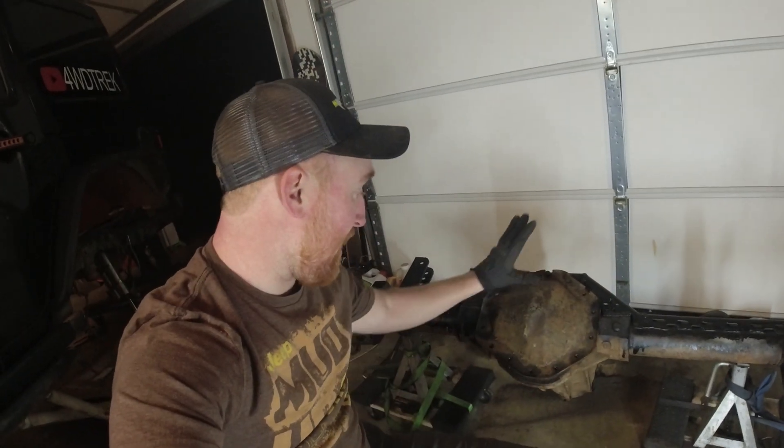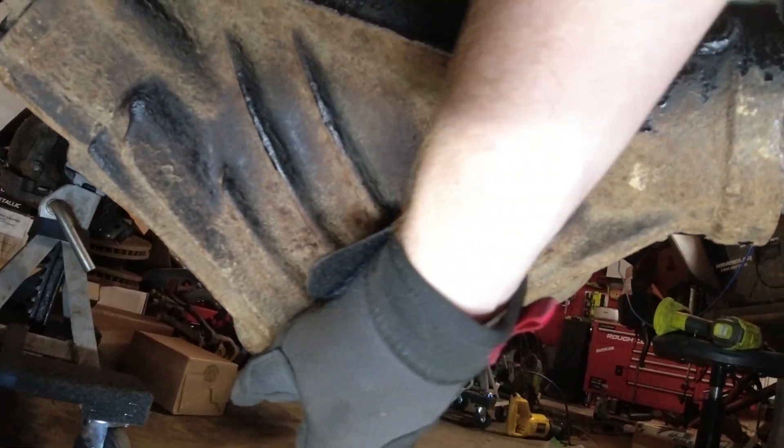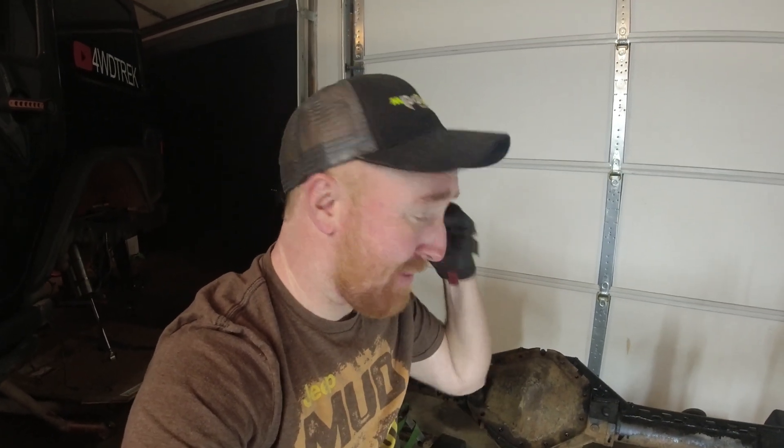So what is the actual point of doing this? Looking down here, we have this big gigantic rear differential with a big notch at the bottom that hangs down almost two inches. It's the perfect place to catch everything - rocks, boulders, stumps, sticks, dirt mounds. So I'm gonna do the non-welding shave of the bottom differential. By cutting it off, we gain about an inch and a quarter. That doesn't seem like a lot, but if you're lifting a whole Jeep three inches, that's a third of the entire lift that's still hanging down underneath the differential. An inch and a quarter is still quite a bit, and you'll have a front end that's not notched - it's gonna be nice and smooth so if your differential does hit something it'll slide right off.